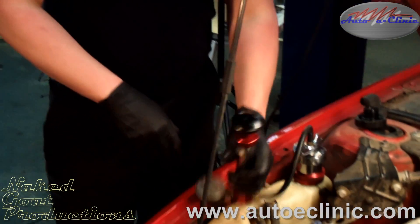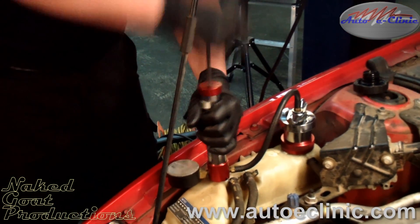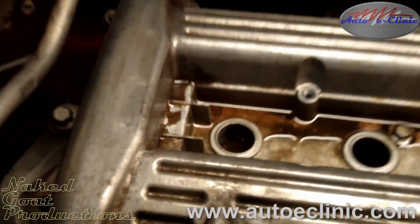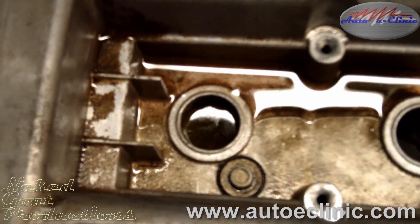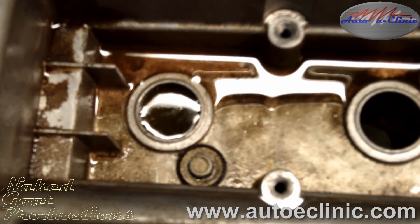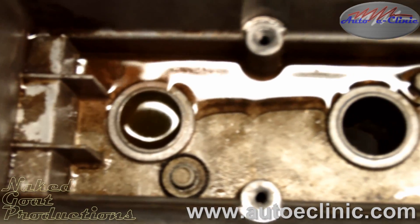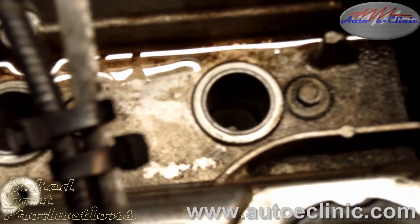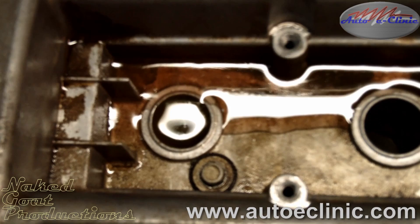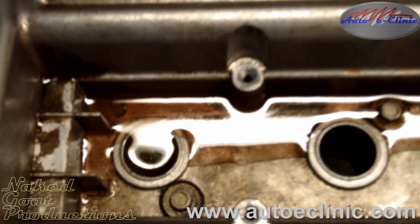To give you a better idea of what's happening here, Mike is going to hook up a pressure tester to the coolant system. This is going to pump pressure and simulate the coolant system in operation under correct temperature. As you can see, coolant is rising out of this spark plug hole, and this is what's happening under driving conditions. Ladies and gentlemen, that is not a magic trick — I have never in my life seen this. It's safe to say we probably do have a cracked head.